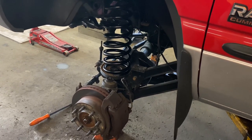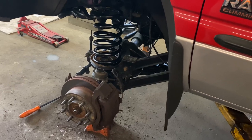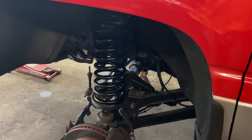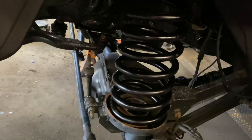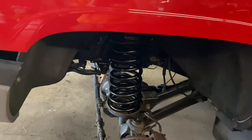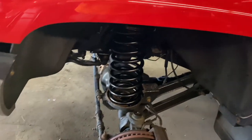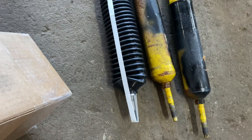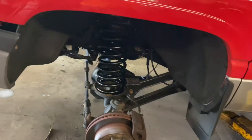Come down and look at the suspension — wow. Go easy with it. Next is getting the sway bar links hooked back up and the shocks in. Get the shock tower back up above the shock and then you can cut the straps — the shocks are held in by straps. Don't cut the straps until the shock towers are on top of the springs, or the shock is inside the coil and you're in trouble. But they're in — on to the next segment.